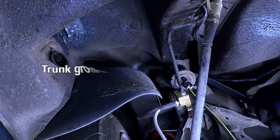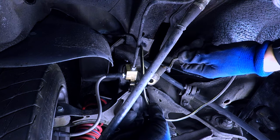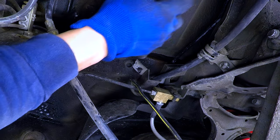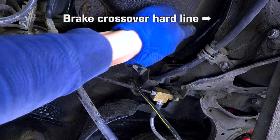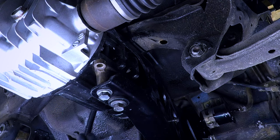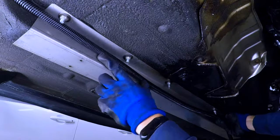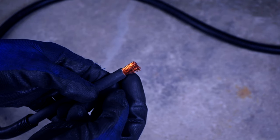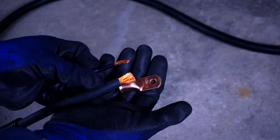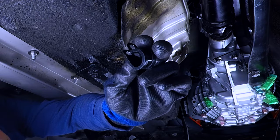That's how it's going to sit and the cover goes over it, but for now I'm going to disconnect this as we work on the other side. Here's the cable that's run through the trunk floor — this is the stock ground cable that runs off of the negative terminal of the battery. I'm also going to replace this with a thicker gauge wire, but that's going to be a little bit later. The stock Miata power cable runs along the right side of the body on the PPF, and I mentioned I didn't want to run this one that way. Instead, I'm going to run this along the rear subframe, basically in the same area as the brake crossover tube. No zip ties, no race car. This is going to come up on the left side of the frame rail to the left side of the engine bay. The other end of the cable goes to the starter and we need to crimp on this copper lug. The stock Miata wiring also has a cable that goes from here to the fuse box which provides constant power, and we're going to use this 8-gauge wire to do that. These are 3/4-inch wire holders.